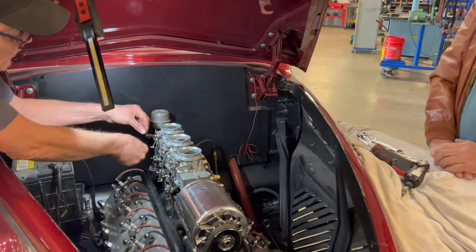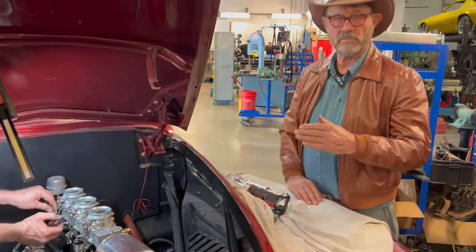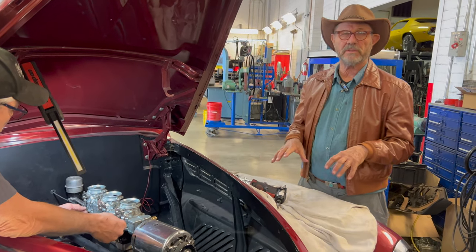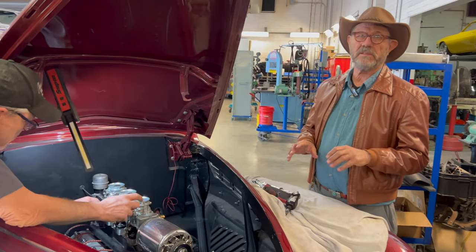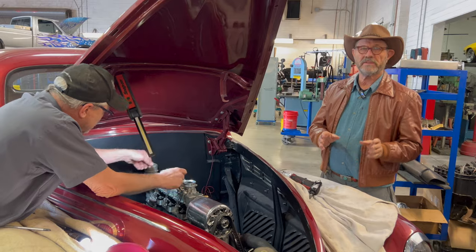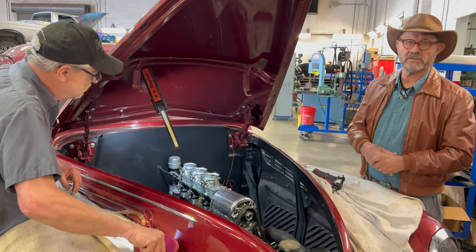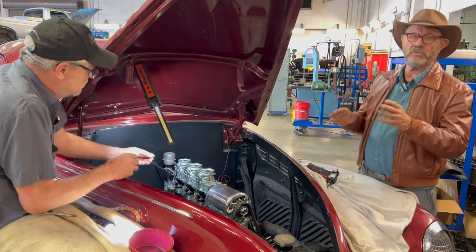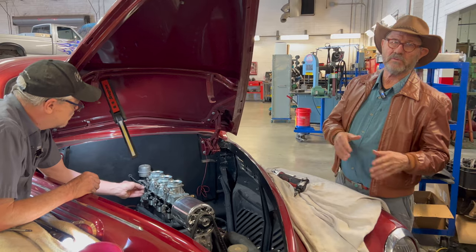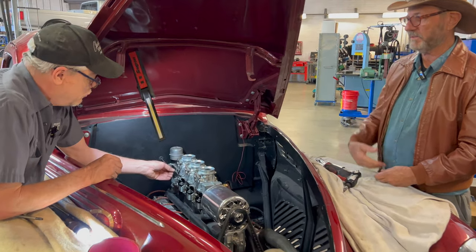So in other words, you don't want to flood it. Correct. You want it to come online progressively, is the expression. So when the engine's going at low speed, you want to put in, let's say, 2 units of fuel. You don't want to dump 4 more units on top of that just because you're going 5 miles an hour faster, if that makes sense. You want a smooth transition between less fuel and more fuel, not a big dump at one stage. Is that true, Dave? I mean, is it pretty much true?